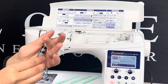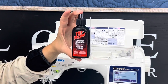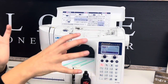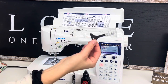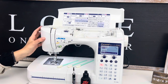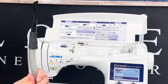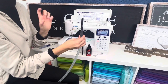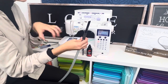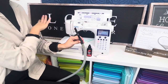We'll get to oiling — don't worry. We have the refill bottles here, and there's also a six-ounce option on the website, especially if you have a TL machine. We'll link the description to how to clean your TL machine if you have a Juki TL. I have a little T-screw to take off my plate, a Phillips head to open the little side cover, and my favorite part of the cleaning process: a vacuum with a skinny tip to suck up all the dust and lint. No canned air, no blowing — the point is to grab it and take it out.